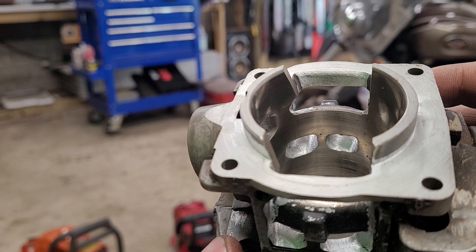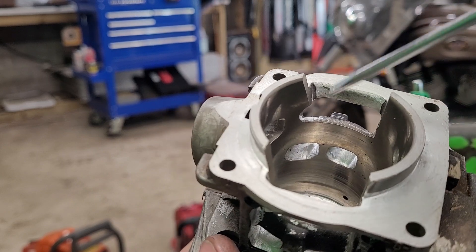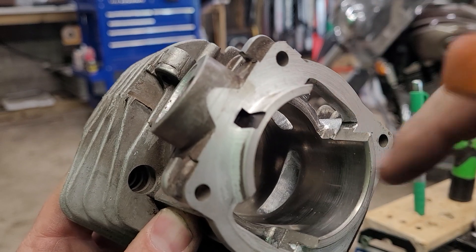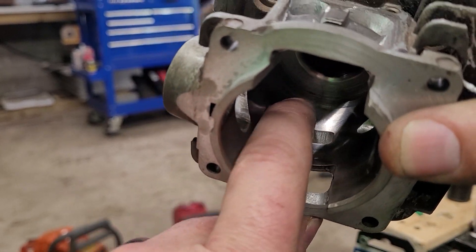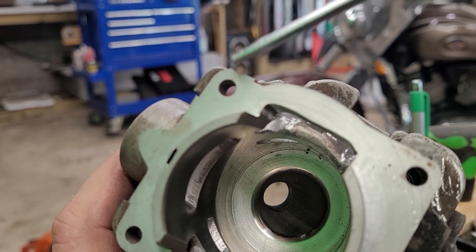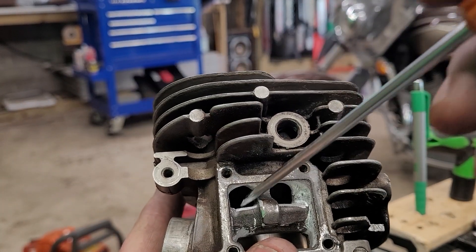So we're at about 118 degrees when the blowdown kicks in, giving us about 14 degrees of blowdown. He had suggested aiming for about 16 degrees, but there it is — we're done. I've got it all smoothed out with a nice bevel on the exhaust. The transfers I just did with sandpaper, no bevel. So: 40 thousandths out of the squish, about 25-30 thousandths off the base, giving a squish of 21 thousandths, 104 on the exhaust, 79 on the intake, and 14 degrees of blowdown.